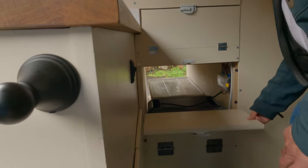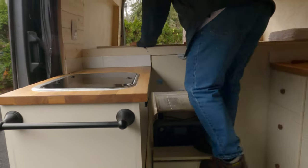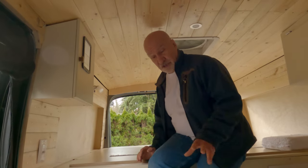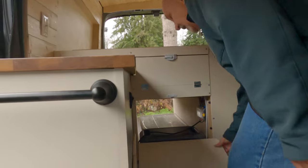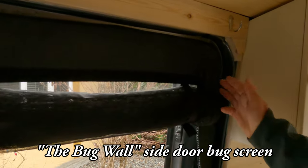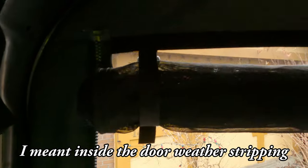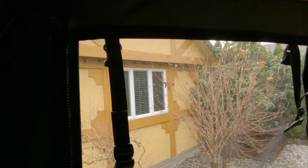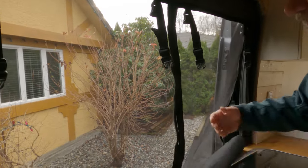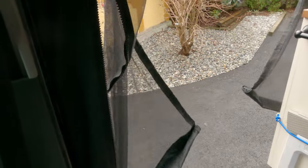With this fold-down configuration and two very strong hinges on three-quarter-inch plywood, it provides a step up to the bed, which is higher than you'd like but necessary to accommodate the mountain bikes. The step folds right up out of the way. We also have bug screens that are sealed inside the side door enclosure on clips — they fold right down and zip tight on the sides, and are also magnetized between the two panels so they cinch together and close behind you.